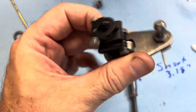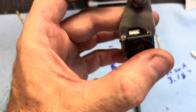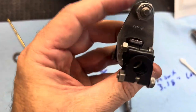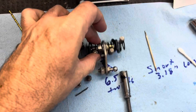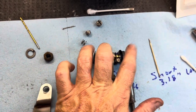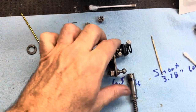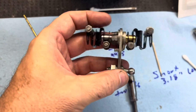What you do is get this to sit flat with the tongue — both sides — get it flat with the tongue, and that's a good starting point to lock it in. When you adjust your carbs later for syncing and you have to loosen these to disconnect, just loosen the outer two if you can, not the inner two — that way they'll stay where they're supposed to be. But I don't think it really matters. Anyway, that's how I believe it should go back together — it's fully adjustable, but I think that's going to work. No grease on this — you want it to crimp down hard.